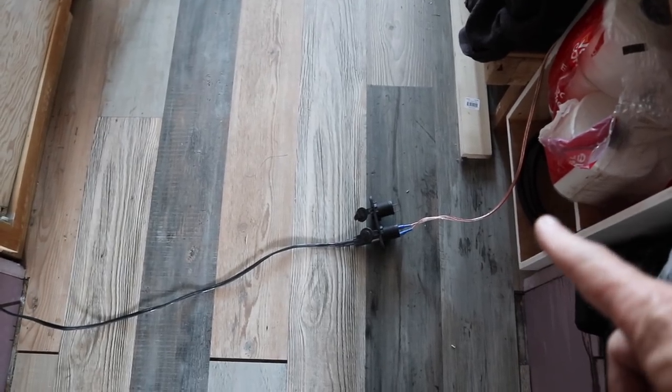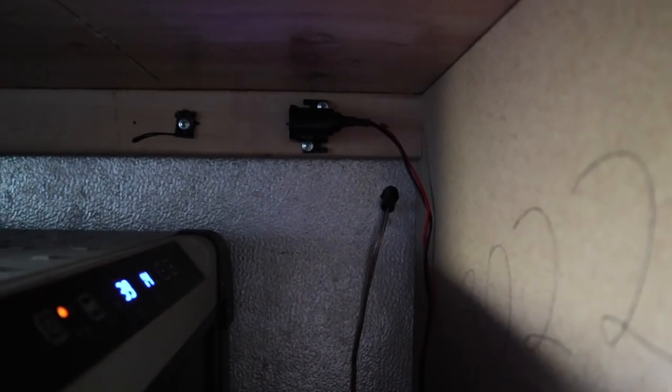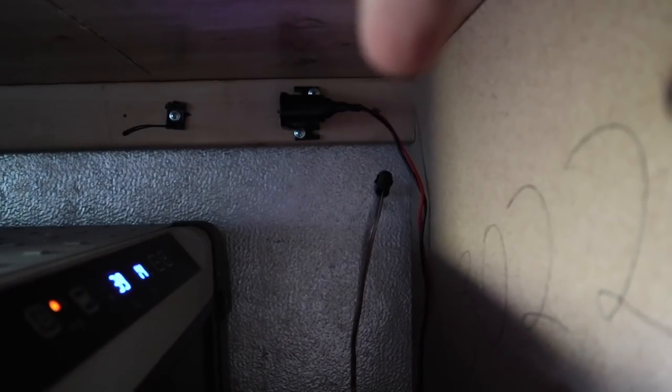I did have a little bit of issues with the power. I ran a clean power source all the way from the power box near the driver's seat, up through the ceiling and down through the wood panels back here. But the gauge wire I used apparently was not high enough gauge — the voltage drops as soon as the compressor kicks in, and the fridge is sensitive to that so it shuts off. I had to temporarily borrow power from the passenger side, going across the floor — not ideal, but at least I've got power to the refrigerator for now and I can rewire it later. Here you can see the 12-volt plug, and I just need to run some higher gauge wire up to the power box so it won't short out.